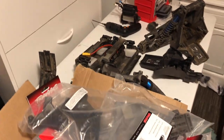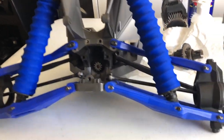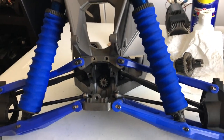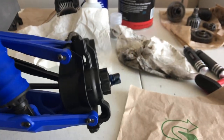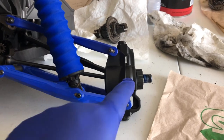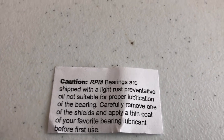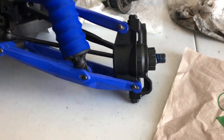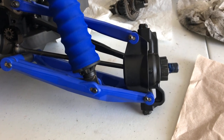I appreciate everybody's prayers — it means a lot to me, all your support. I've got most of the front half put together now — switched everything over: all the steering, the new A-arms, bulkhead — all new right here. Except for the shocks, which I rebuilt. Don't forget, if you guys end up buying RPM — like I did with the carriers and stuff — the RPM bearings they send: if you read the little note, it says 'bearings are shipped with light rust preventive oil, not suitable for proper lubrication.' So you're going to have to grease your bearings. I've seen a lot of guys on videos just get the bearing RPM sent, put it in, and run it without reading the note. Make sure you grease those bearings.